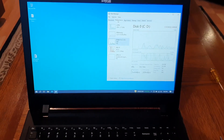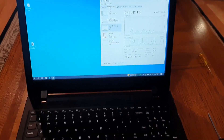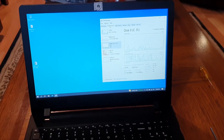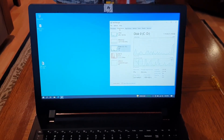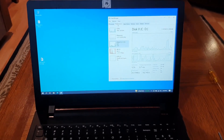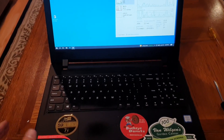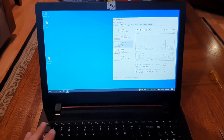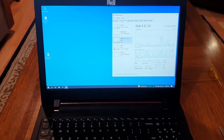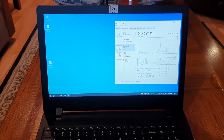Look at this — the system just sitting idle uses 3.3 gigabytes of RAM, and it shipped with 4. As you can imagine, trying to do anything on this machine would have been sluggish. The RAM upgrade to 12 gigs and swapping the mechanical drive for a solid state drive definitely gives a big increase in performance, and it's relatively cheap. If you have one of these laying around and it's too sluggish to use, get a stick of RAM and a solid state drive, spend 30 minutes to an hour on this, and it's not a bad little machine once you upgrade the components. Thanks for watching — this is Gizmo Joe signing off.